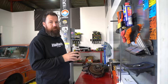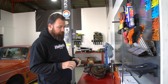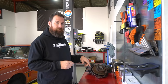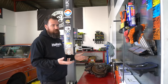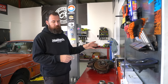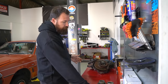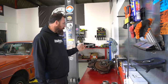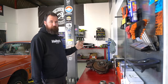To complicate things further, the Sigma strut body is 51 millimetres, which doesn't seem to be a particularly common size. We were lucky enough that John from V-Sport actually had these lying around and sold them to us pretty cheap. I'm hoping we'll be able to get this whole front coilover together for about 500 bucks, which is pretty cheap compared to buying, say, a BC coilover and still having to weld it to your lower leg. No one does a camber plate style strut top to suit the Sigma that I'm aware of, so we're currently going to reuse the standard style strut tops and may even make something down the track to convert to camber tops.